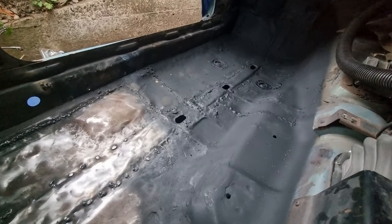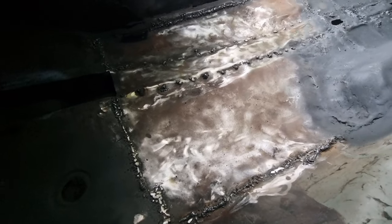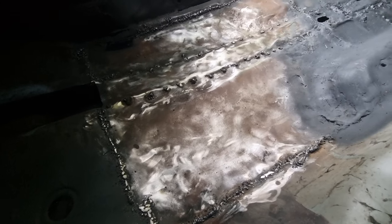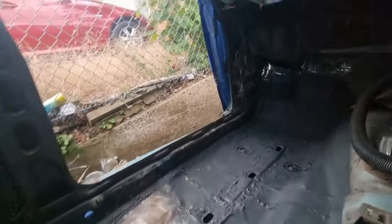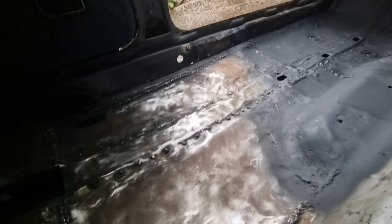Right, that's it for today. I've got a little bit to do up there still. I've welded all of this and I've just got to grind it - that'll be next time. It's quite late now and I've been doing this pretty much all day. Started welding up all the holes I had over there - no holes in that pillar anymore. Just got to grind that down, I've got a couple of little ones there to finish. I've managed to fill in that blow-through there, just got to grind it down, put a plate in there. All in there is treated and stone chipped, got to put the drain plug in there and seam seal it, then grind all that down. That'll be in the next video.